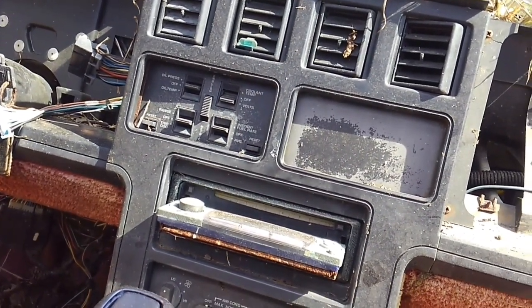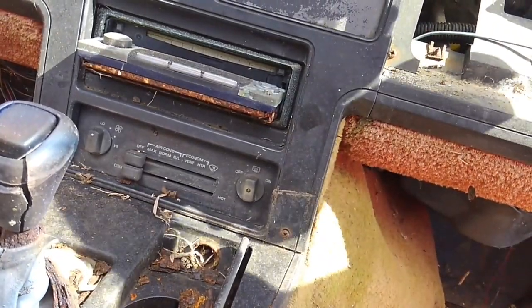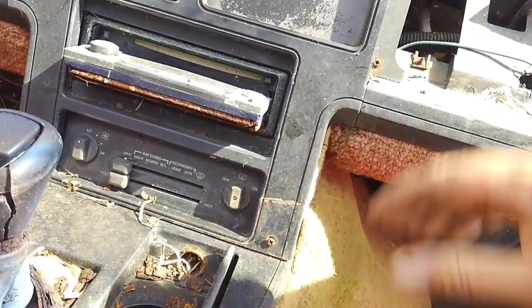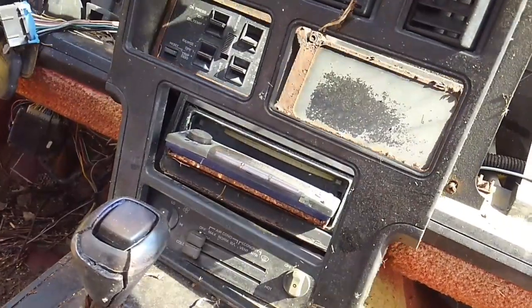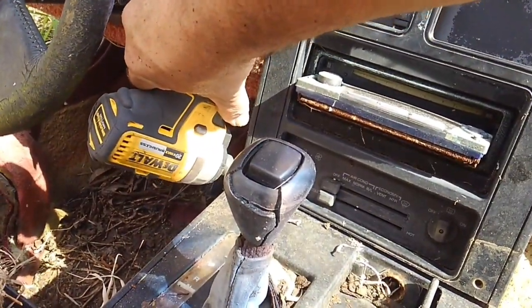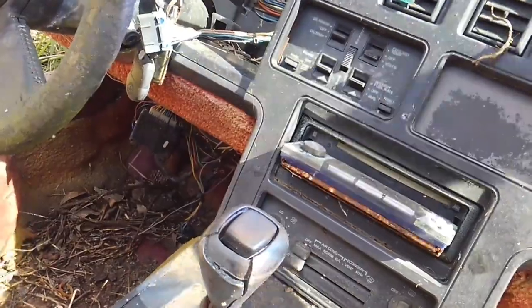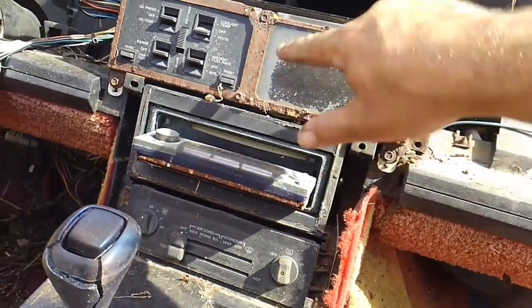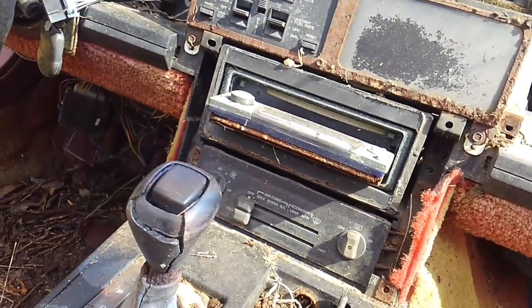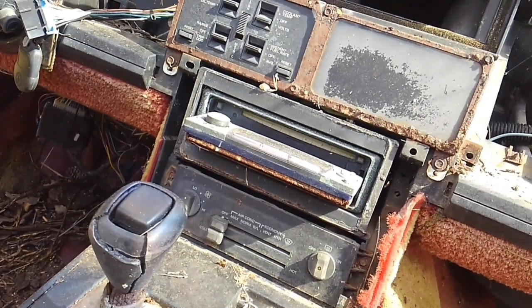First things first, you're going to want to take these screws out here to remove the outer panel. We've got those out already. It's a little bit easier since I've already got the dash top out. There are four screws on this side, and there are going to be two more on the other side where the other bezel comes across on your instrument panel. When you get to the actual DIC panel itself, there are only three seven-millimeter bolts that hold the entire assembly on. You do not need to take the smaller bolts out — those actually stay with the DIC panel.